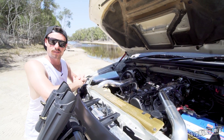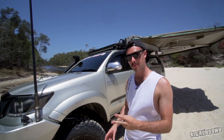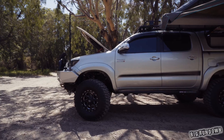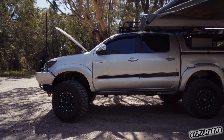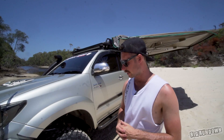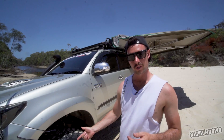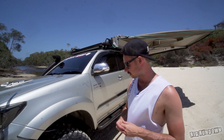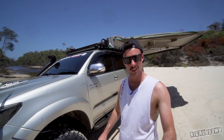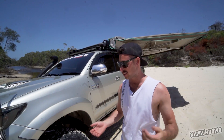Last thing is underneath the car — the lift. It's basically a two-inch suspension lift and a two-inch body lift. Fox struts all around, SPC upper control arms. The rear leaf springs are standard but upgraded to 660 constant-load with Superior Engineering extended shackles to get that lift. It's running 35-inch mud terrain tyres on fuel boost aluminium rims. The exhaust is a straight-through three-inch with a stainless tip on the back — sounds mean.